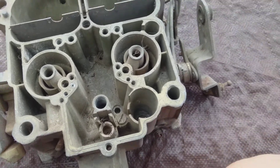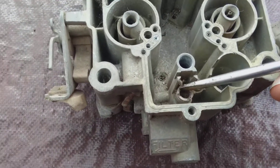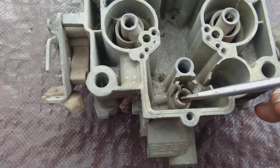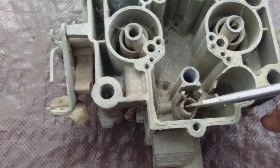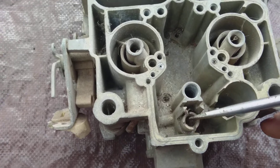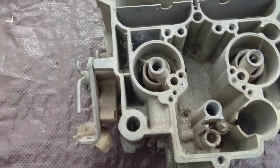E85 Q-Jet 101 information. First thing is the fuel inlet — you have to open that up to .152. You then have to get a check ball and make another seat because nobody sells these big enough. .152 seems to work. Going bigger, you're going to run into problems with the needle actually contacting enough of the sides to seal it off.